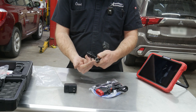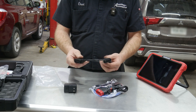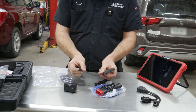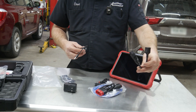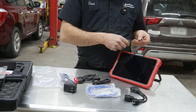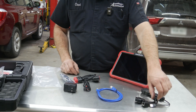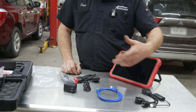This one has an RJ45 ethernet port on it — this is probably for some of the newer vehicles that use diagnostics over internet, DOIP. We also have a USB to RJ45 adapter, probably an ethernet adapter for the Android unit, so vehicles that are diagnostic over IP we'd connect right here with a short ethernet cord from the USB port. Some of the newer vehicles that use that protocol are European stuff like Volvo, BMW, maybe Jaguar. I'm not sure if stuff in America is using it yet — they're probably still doing diagnostics over the OBD2 port with that protocol built into their factory VCI.